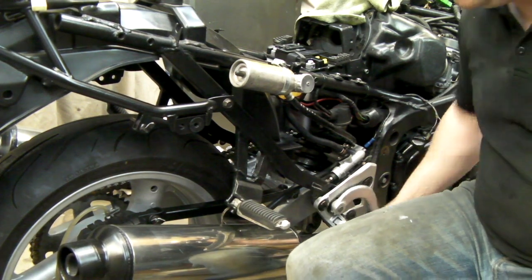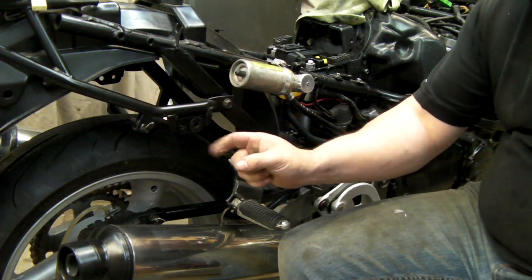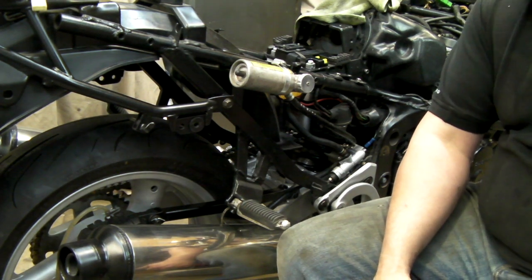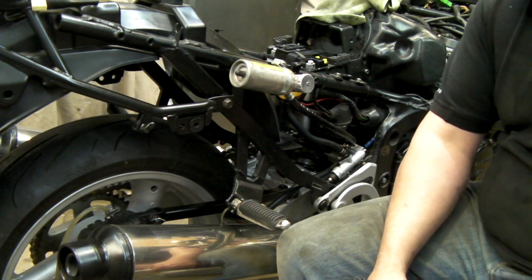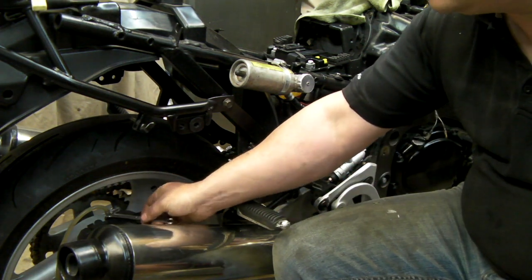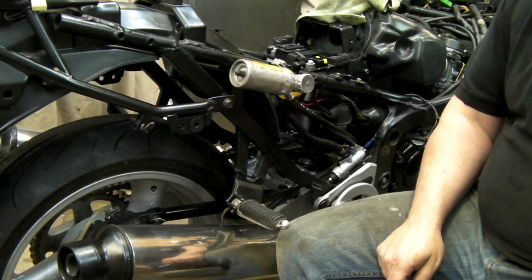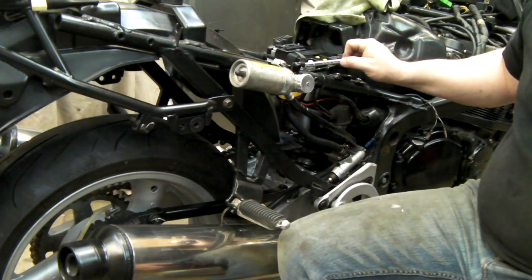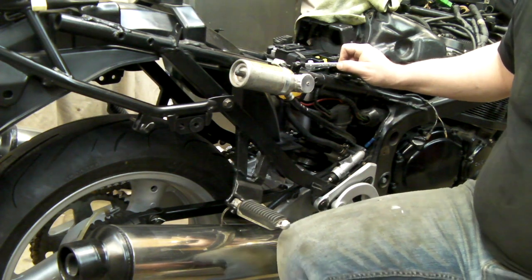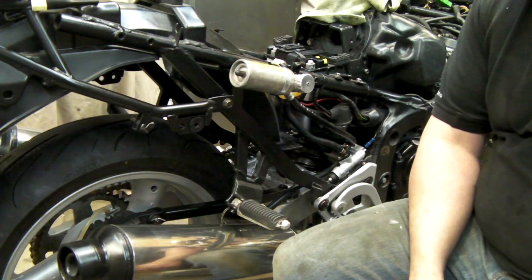What we're going to do is pump it up a bit and get the pistons working in the back, because as they move they'll move the air around and hopefully it'll come out through the bleed nipple once I reopen it. You can also just undo the bleed nipple and leave it open — gravity bleeding does work, it just takes a long time. You must remember to top up the reservoir regularly. Personally I like to push it through — we'll come back in a little while.